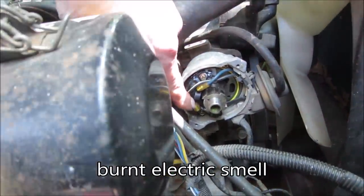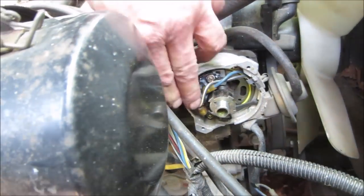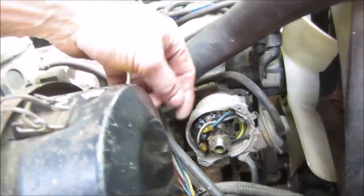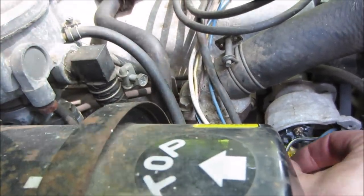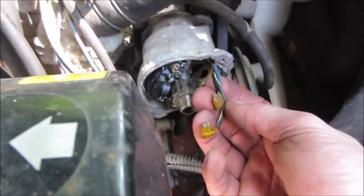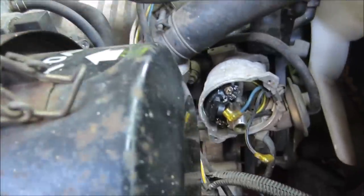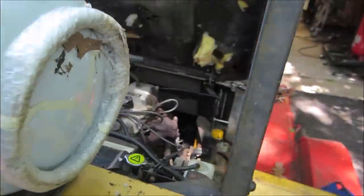It doesn't seem totally wobbled out, it feels hot. It's warm - but it's just as warm as a regular part of the distributor. I don't know if that has a gap to set. I'm gonna need two hands. I probably have another coil I could plug in - just put like a VW coil on it. Could be that ballast resistor too.